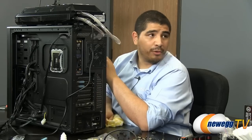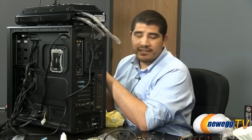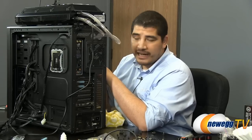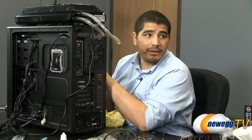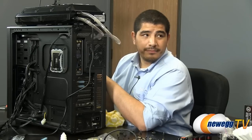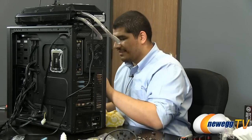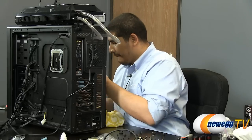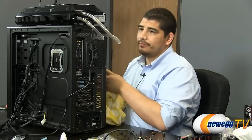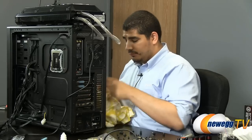But it's super important that you do so, because things like TRIM or native command queuing, which are advanced performance aspects of your drive, will not work without AHCI operation. Running an SSD in IDE mode is like killing your SSD. You might as well have bought a mechanical drive. So definitely worth doing.